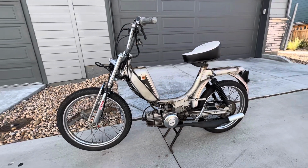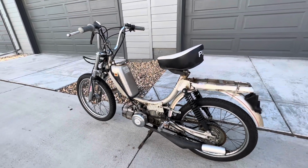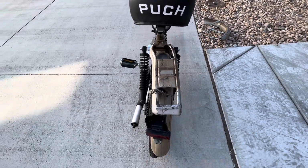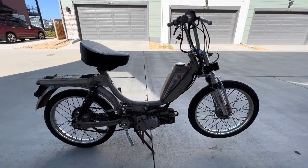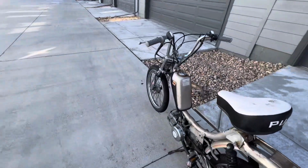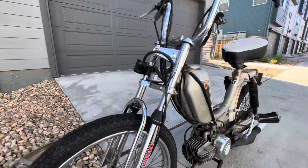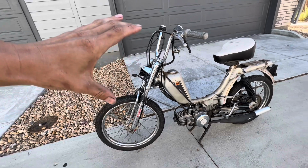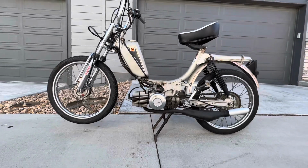Just picked up this non-running 1980 Murray Moped powered by a Puch E50 engine. This was previously run over by a truck and then was left outside to rot for who knows how long. Previous owners replaced the front forks with EBR racing forks, which are in the chrome, but were maxi size. A Murray actually uses Free Spirit and Magnum length forks, and they installed maxi length.